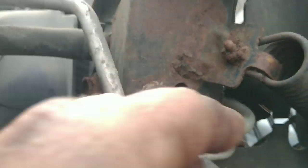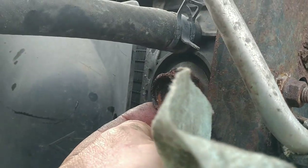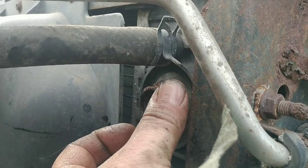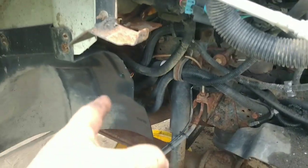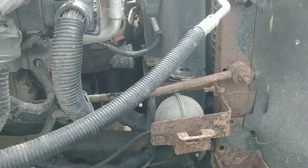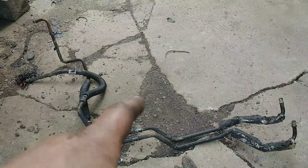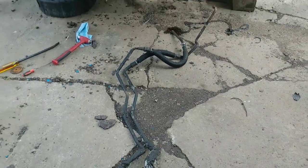It's pretty cruddy. Shove rust into that O-ring and it leaks. So we're just going to order new ones. It looks like these will just come out of that radiator on an O-ring fitting. I'll only pull one out at a time so the cooler doesn't come loose. I'll take one loose, replace it, then take the other one loose. I'm going to replace these because at the dealer they're like $30 a piece. The transmission lines are still available from the dealer but they're about $100 more for the pair. The fittings were quite a bit cheaper.